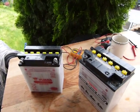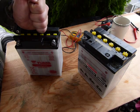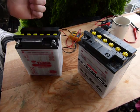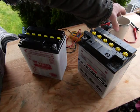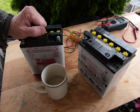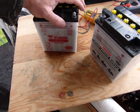When you handle the batteries, wear appropriate clothes that are kind of sacrificial clothing. Do not tilt the batteries when you remove them much. Do not hug your batteries, do not keep them close to your body if you can. Don't be turning them upside down, and don't be looking at them without safety goggles when tilted on the side. Handle it like an open container, like a cup of water or a cup of coffee. The sulfuric acid inside, if it leaks out, is going to chew through your skin without any problem.